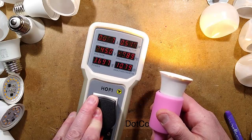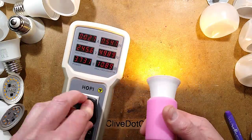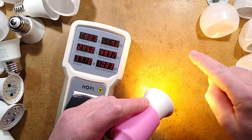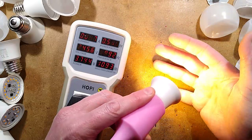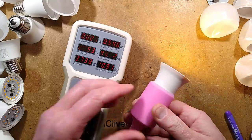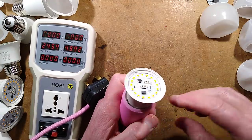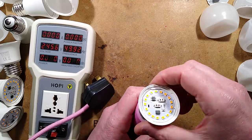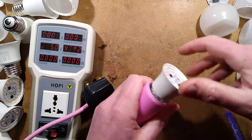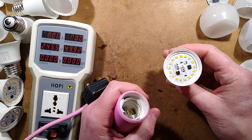3.7 watts - not bad. It's gone from 8 watts down to less than half, and it will be more efficient. It's not going to be putting out half the light - actually a bit more than that relatively. It's warm white, looking lurid yellow here just because of the colour balance of my lights. More importantly, it's going to be running cool. Keep in mind the front of this is mains voltage - you could stick the cover back on, or if you live alone you could put it into certain light fittings with the open front, which looks great in chandeliers as it casts images off the LEDs. It does pose an electrical shock hazard.